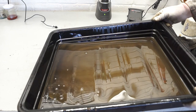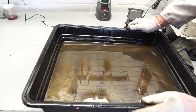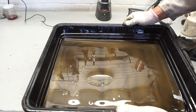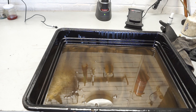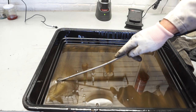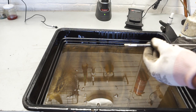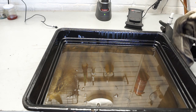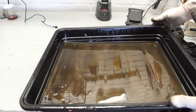That's our oil drain from the car. You'll be able to see it has quite a brassy colour to it. This oil is probably only about three or four hours of actual race time on it, and it did look overdue a change. You can see all the metal particles floating about. I'm going to run a magnet through — they're all fairly small, but they're certainly going around in the oil. It certainly seems like a good idea to stay on top of changing it.